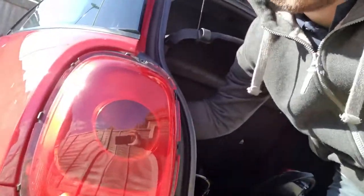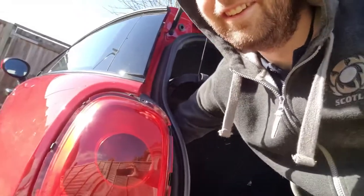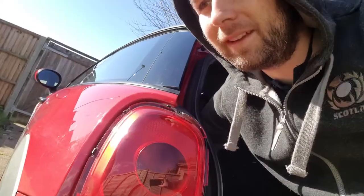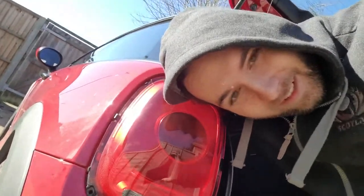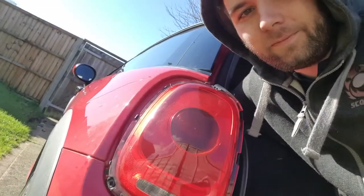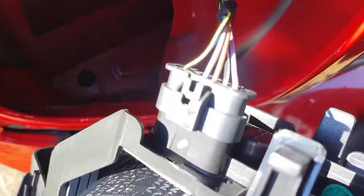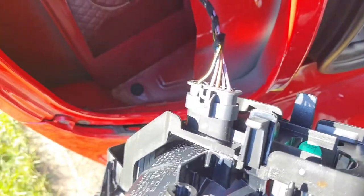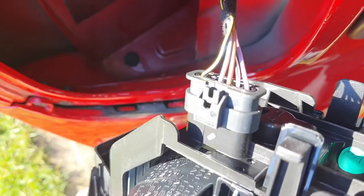The one closest to the centre of the car is the more difficult one — it does require you to do a bit of gymnastics with your hands to get all the way down. Once you've got that clip the light comes out. You'll see you've got the cable leading to the connector in the back. There's a little tab on the back of the connector — you literally just push that tab in and pull out the connector. It might take a little bit of wiggling. Try not to pull on the wires because you might break the little pins inside.